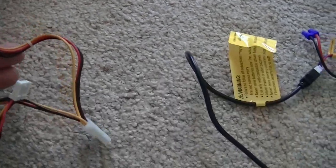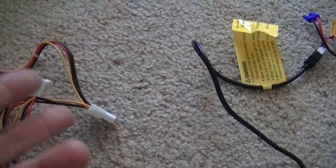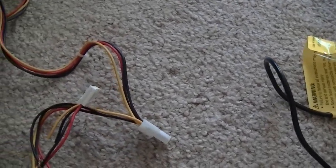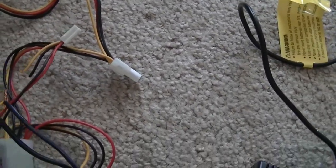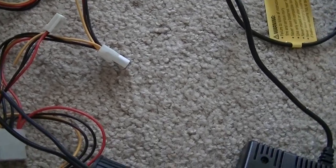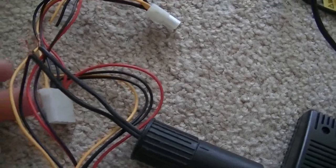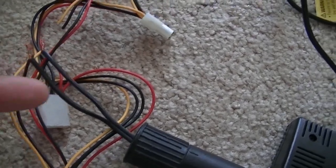You get all these wires that come off of here — these are all your daisy-chained power connectors for your accessories in your computer, such as your disk drives and other peripherals that require either 12 or 5 volts. Yellow gets you 12 volts, red gets you 5 volts, and black is ground.